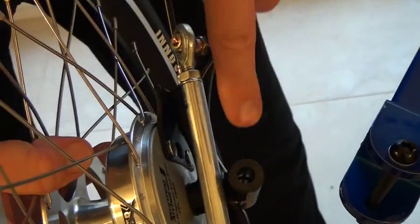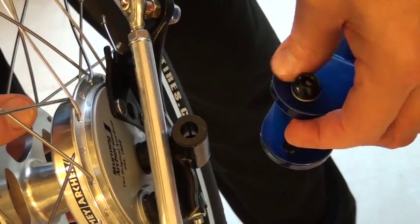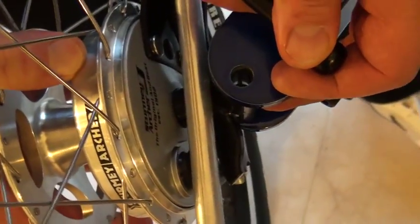I'm going to lift this front wheel up. The kingpin bolt is actually going to go right through the steering knuckle at that point. I'm going to lift the kingpin bolt out. I'm going to slide the steering knuckle into the clevis until the hole lines up and then I'm going to put the bolt through.